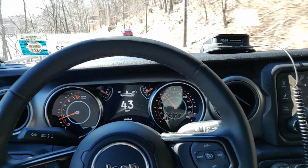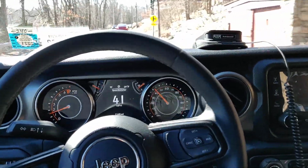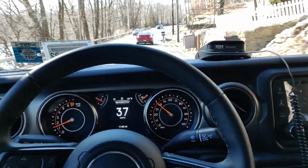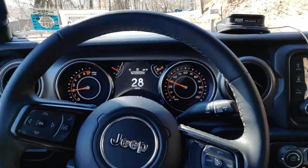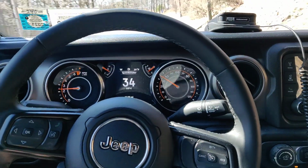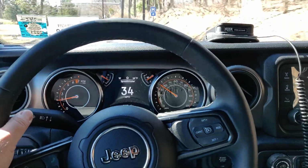My truck's stock. I called Synergy, and they said that you can in fact fit the steering reinforcement bracket that they make on a stock Jeep JL and JT, providing that there's a minimum of 2 inches between the bump stop and the axle, which in my case there happens to be a lot, probably say 4.5 minimum. So if it loosens up at all, I'll probably go that route and replace the bracket.